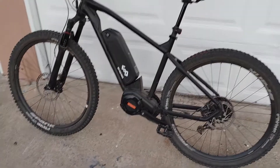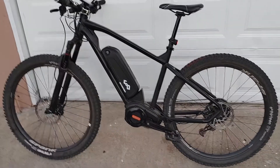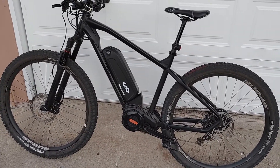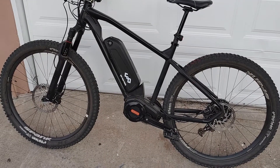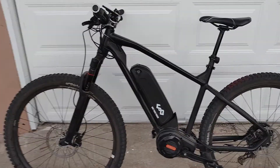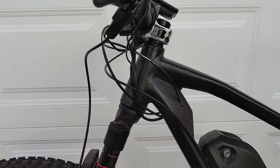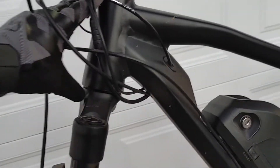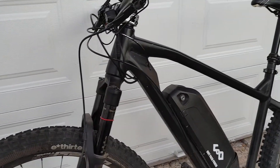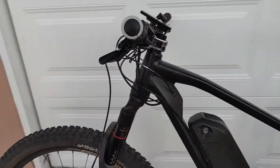Handles really nice. This frame was the only frame I could find with the G510 motor that had the shortest chain stays — I think they're 460, could be 464 or something. It has decently modern geometry; the front head tube is a 67-degree head angle. It's a little long, I prefer it to be a bit shorter, but it still works. I didn't have to cut the fork — luckily I cut it correctly.